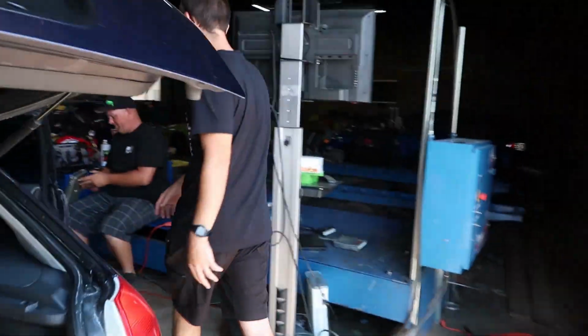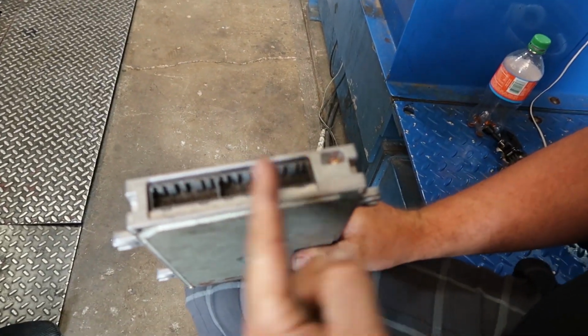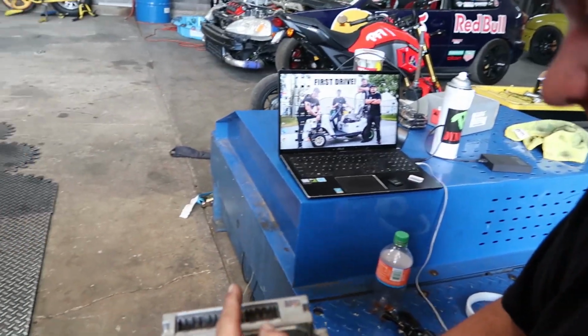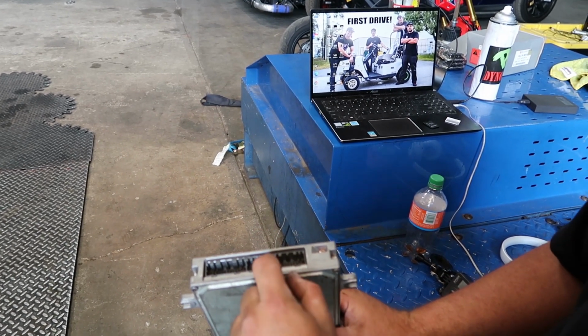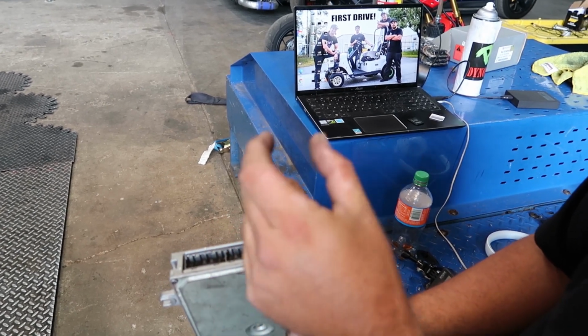All right, let's show everybody how you pin an ECU. You've got A, B, D, starting from the left, looking at it. What one are you looking for? D12. So for D, you've got 1 on the top, and then 2, so you can start here: 2, 4, 6, 8, 10, 12. So you can take the harness side of it.